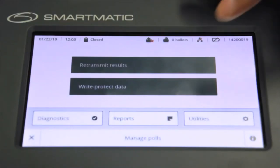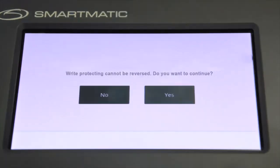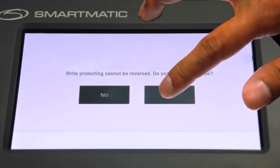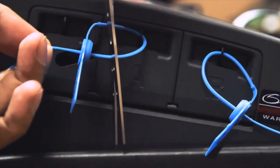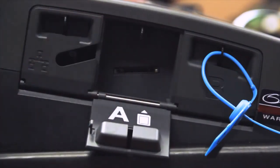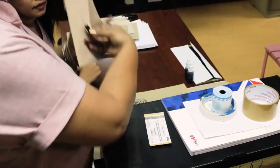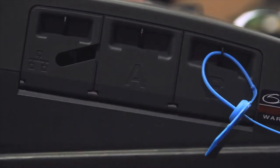From the main menu, press Protect Data. The chairman should enter his or her role pin. The VCM will prompt the user to confirm the lockup of the external SD memory. Press Yes to confirm. The VCM will lock the backup memory, display a message informing about the result of the operation, and will automatically shut down. Do not forget to remove the main SD card from Slot A and place it inside the envelope. The backup SD card shall not be removed from the VCM, and the cover of Slot B shall remain sealed.